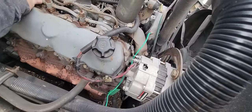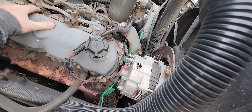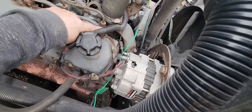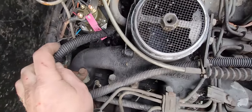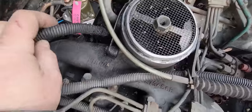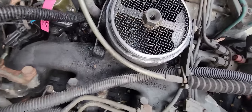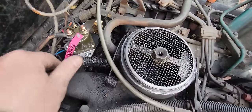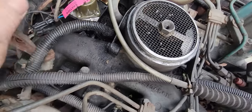But look at that. There's O-rings underneath here, and it's not uncommon for them O-rings to not leak fuel but leak air. So the best thing to do is we take all these lines off and replace all of this. Oh, look at that mess. I wonder if we're leaking in there somewhere. Yeah. I wonder if there's been a mouse or chipmunk chewing in there, because that's soaking wet. Anyways, we have to find where it's letting the air in the system.